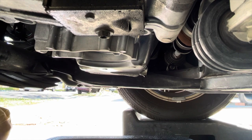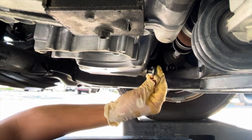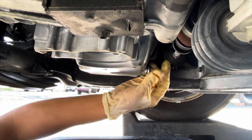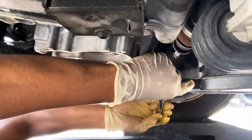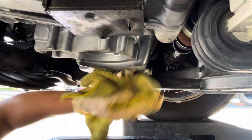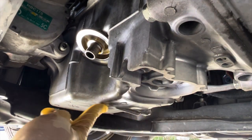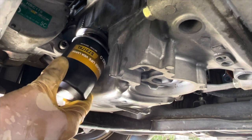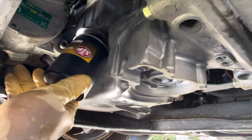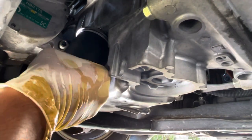So the car is pretty much not dripping anything anymore — I'm pretty sure we got all the oil. I have the drain plug here, so what we're going to do is just thread it on. The crush washer was in good condition so I was able to reuse it. Now we're going to line up the oil filter with the threads. Same thing as the plug — it should go in easily and straight so you don't cross the threads. You should be able to get it started by hand. Once it slows down you just give it a twist — it won't need to be any tighter than what you get by hand, using the material of the filter itself to get the grip.